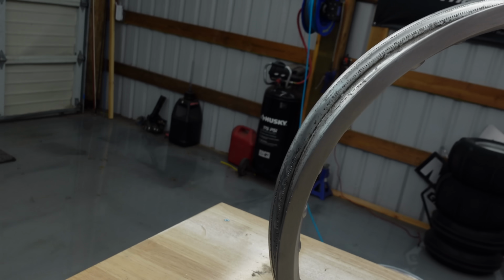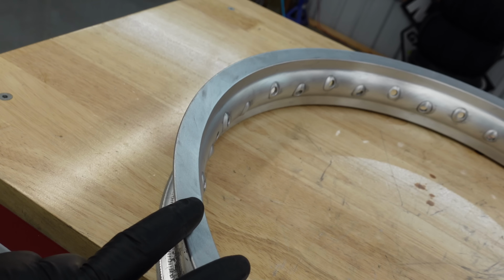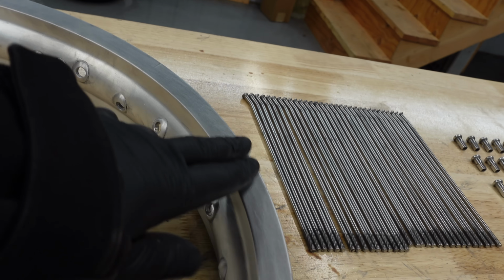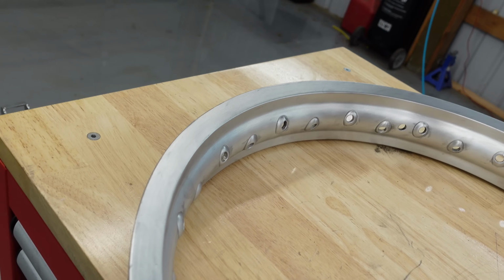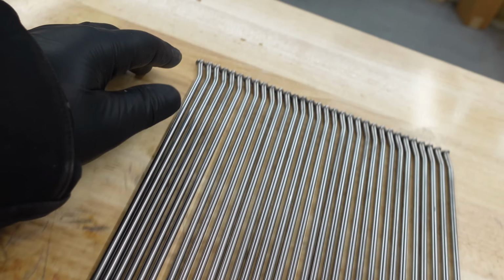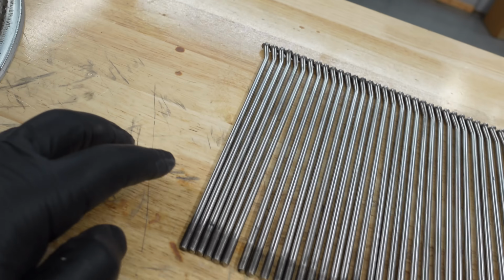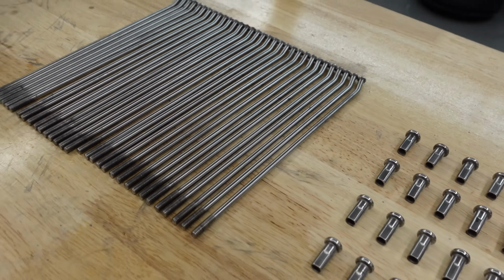This rear is actually a Warp 9 rim. I think it was still silver and somebody had to spray paint over it because it was really starting to chip and flake. Powder coat doesn't typically do that. So as you saw in the video, somebody did a terrible job at lacing them up. There were still a ton of gaps on the ends where the spoke meets the hub. Half of them were tight, half of them weren't. It's just sad to see something like that happen.